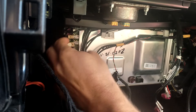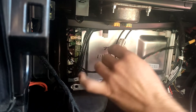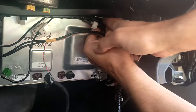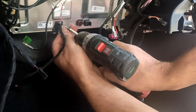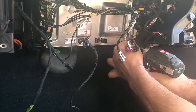Now I will explain how to work with the front board — the MCU computer. You don't need to detach all of the connectors from the sides; we should detach only from the front board. There are four bolts around the perimeter of the case, and some of them are small with Torx 10. We should unscrew those also.